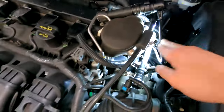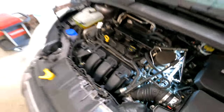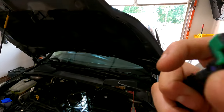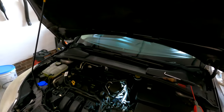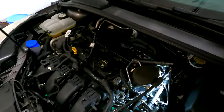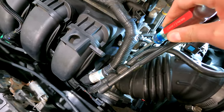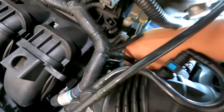On this Ford Focus it's right over here — this is the valve. It's got a connector and loops right to the back. You can see where that green tab is. There are security tabs and the way these work is you just kind of pull them to the side. Take a long screwdriver and pop it out to the side — that one fell out pretty easy.